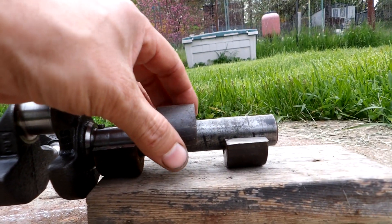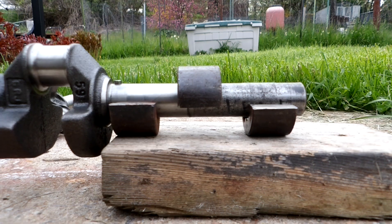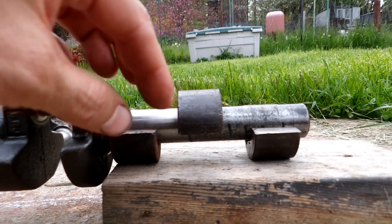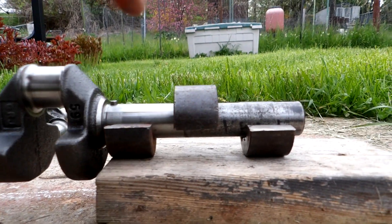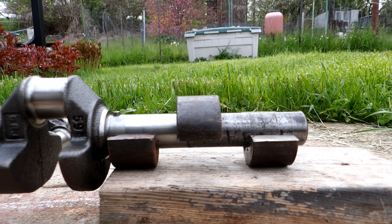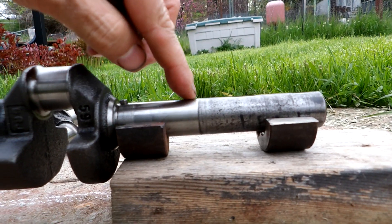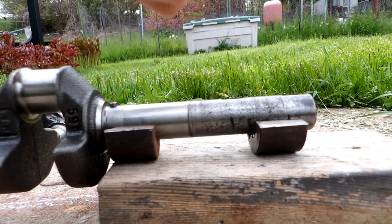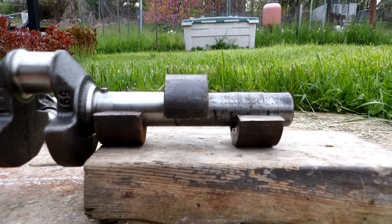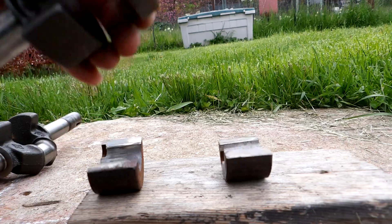I took it over to my son's place — he's got a 10-ton press there. Using the setup I've got shown here, it depends where the bend is, but you move these along and get them set up and then just press on the high side of the bend. They seem to bend right where it comes out of the crankcase cover, generally where the oil seal line is. We set it there, and it took all 10 tons pretty much to straighten them. But we managed to straighten this one.